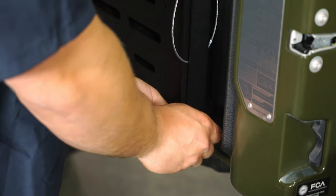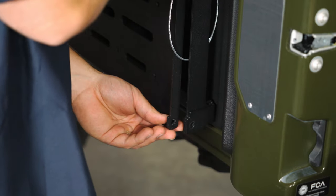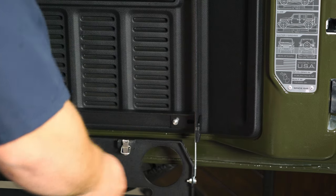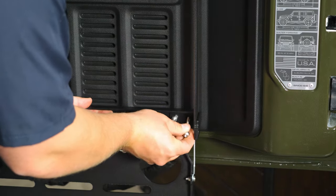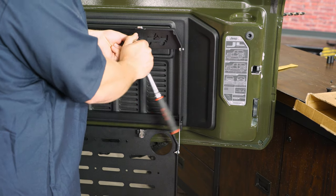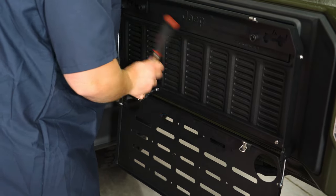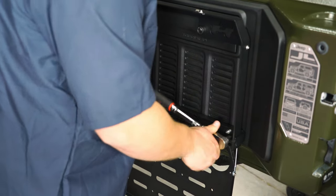To get this off, take the nut off the back side, take the bolt out, and set that aside. I'm going to hang this side up just using the clasp that's provided here, and then repeat the same process on the other side. Now with the lower part disconnected, you can basically hang that down and then grab your two long bolts with washers — they're going to thread right in there. You might have to loosen up the top just a little bit. This is why they say just snug up the top, because there is a little bit of play depending on your Jeep and how it was built. Get that lined up, then use your ratchet to get them tightened down. Snug these up using the four-millimeter allen key and then go up top for a final tighten.